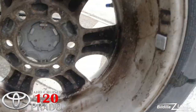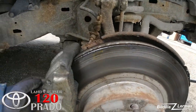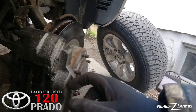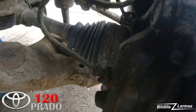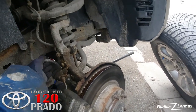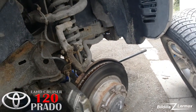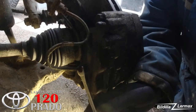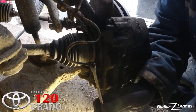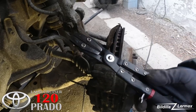You can see brake fluid inside, and also the brake disc — it's leaking in here somewhere in the caliper. Now I have to take off the pipe and clamp it. The pipe fitting is 11 millimeters, but before I do that I have to clamp here to prevent brake fluid from running out.